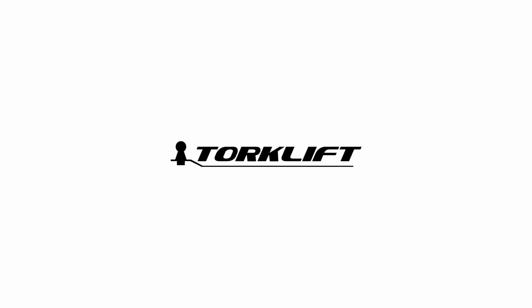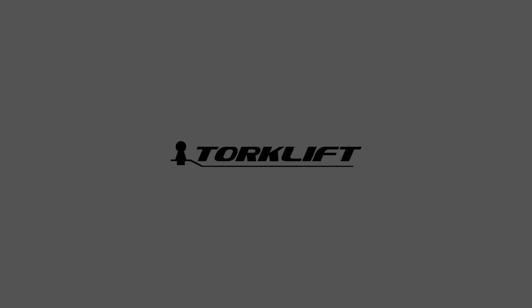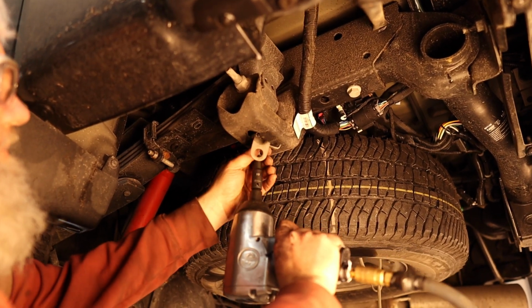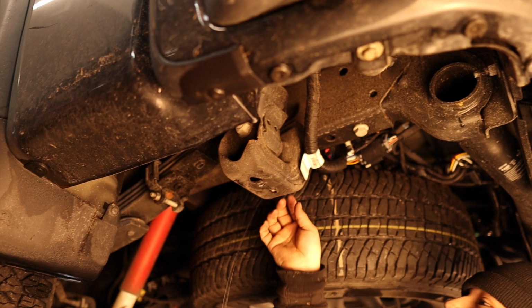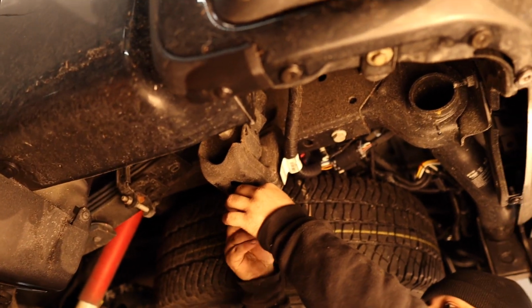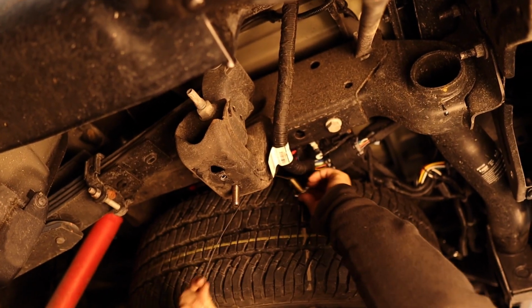Today, we will go over how to install your C3221 and C3222 for your Chevy. First, if you see this tab on your frame, you'll want to remove it to give you access to the hole. Using your bolt fisher, thread the hardware from the upper hole for mounting. Leave the bolt fishers on until finished with the install.